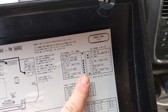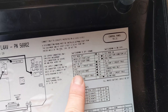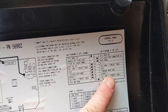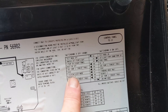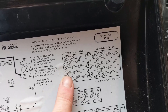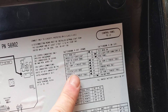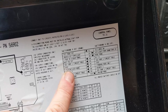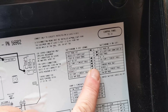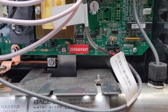So A7 — normally it's off. Standard mode, economy, and sleep mode. If you have kids, switch this to standard mode only. The reason is kids always push the buttons, and there's a combination of buttons you have to push to put it in sleep mode or economy mode. A lot of tubs end up in economy mode and they only heat up to around 85 to 90 degrees, and people think it's not heating because it's stuck in economy mode. So A7, standard mode — make sure that's up. On this one it is up.